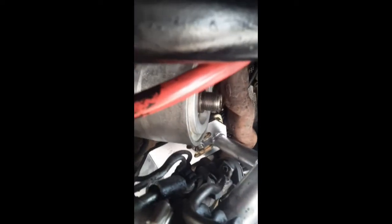I have a socket that fits over the end of the allen wrench and an extension, so I slide it over the end and use it as a handle to tighten it. It's tedious but it gets it tighter. Once it's tightened down, the shaft is actually sitting inside — that's how you know it's all tightened down. Make sure it's tight but don't torque it down like crazy or you risk flattening the seal on the back. After that, put the radiator hose back on and the oil filter back on, and that's literally all there is.